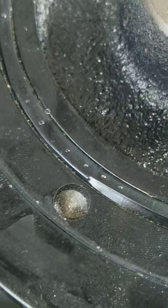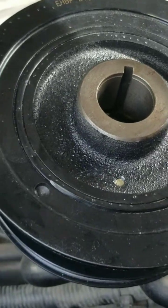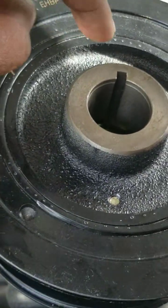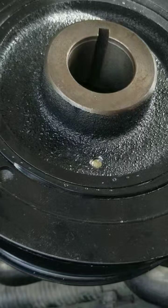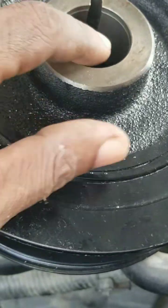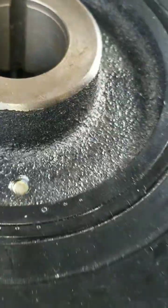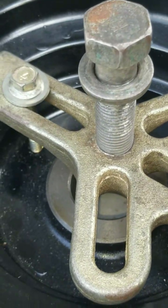When these two rings clash with each other, that causes that noise. Another important part of installing this pulley is making sure the keyway is fit into the key on the crankshaft — very important. Sometimes this keyway can become destroyed and the key will not fit, causing the dampener to vibrate on the crankshaft. Since this is a press-fit, it gets pressed onto the crankshaft at its final installation point. You might get lucky if you have a damaged crankshaft keyway pulley.